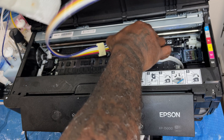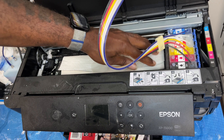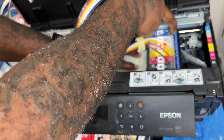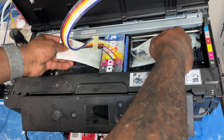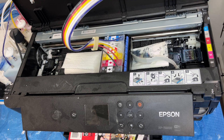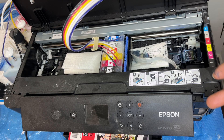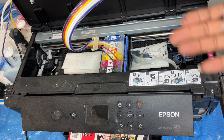Once it's soaked, push the printhead down and lay it flat like so, flattening the top. Move from the correct position, put it in, and do two rubs. Then let it sit. If you just have a small clog, you can leave it for 5 to 10 minutes. If you have a bigger clog, 20 minutes to half an hour. If your system has been sitting for a long, long time and it's really clogged, sometimes you have to give it 24 hours.